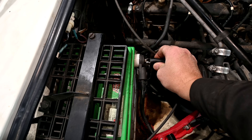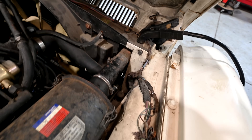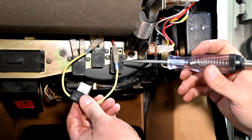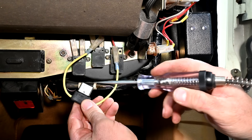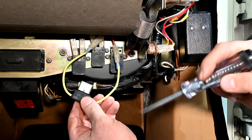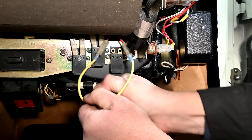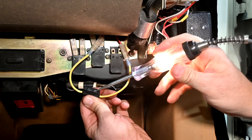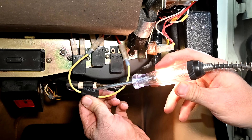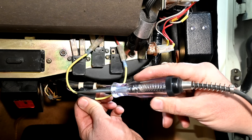Back on the battery side, just to verify our finding, we'll switch our test light to the negative side of the battery — I'm using a chassis ground for the negative side of our jumper box. Back at the fuse, we check one side — there's power — power on both sides, so power is flowing through this fuse and it's good. If you pull out the fuse, this side is bringing in power from the battery; the other side should have none, and it doesn't. So this side is coming from the battery and this is going to the component.